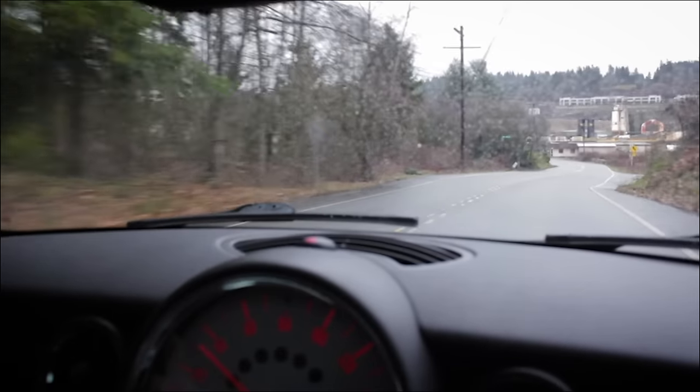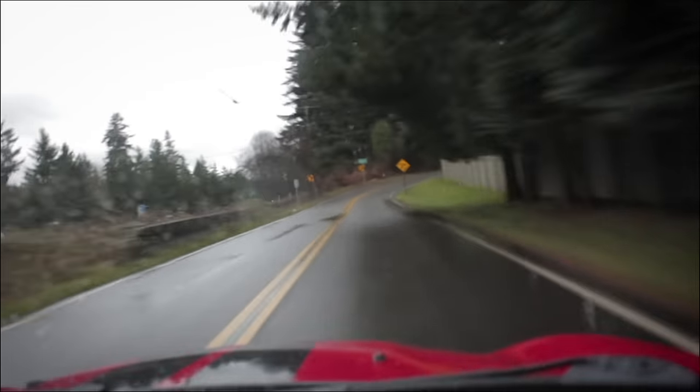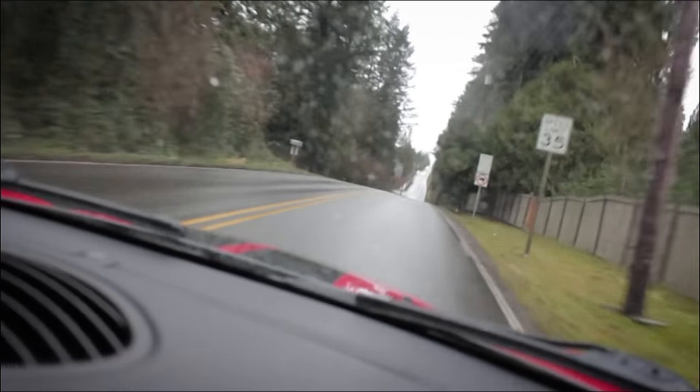It's also important to get the car up to operating temperature, especially with an automatic transmission. Some of them have issues when the car is at temperature, but when it's cold, nothing, it drives fine. So you want to make sure, especially if you're getting an automatic transmission, that it's nice and hot, and that takes about 15 minutes of driving. The clutch pedal should feel moderate. If it's super stiff, that's a sign that you're kind of near the end of life of the clutch.